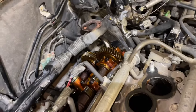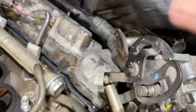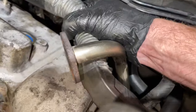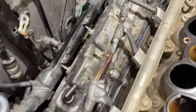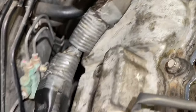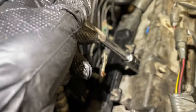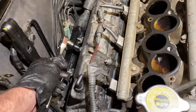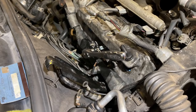We're going to take our cover now and slide it back in. The cam gears make it difficult again on the top, so go in this way and then swivel it around. We're going to pull on the harness up against the EGR tube to get this in without tearing up the gasket. Make sure the gasket's in place and go all the way around — I started to put the bolts back in just to line everything up. The gasket's thick enough that it seems like the cover isn't fitting perfectly, but as you work it and run your fingers around, you'll get it. Tighten the inner ones first and then move to the outer ones — that spreads the gasket out. Do the four inner ones on each side, then move to the outer ones, then go back because they'll be loose again as you tighten down.